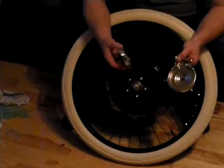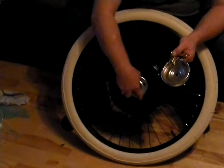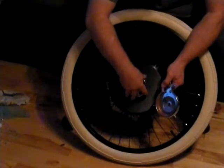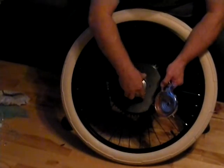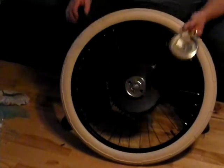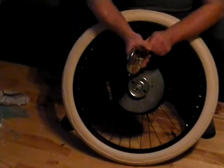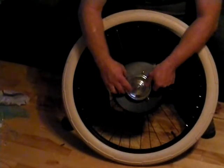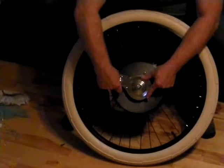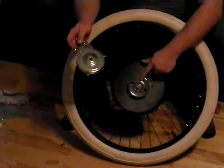The HD Wheel and the HD Axle Kits have brakes. You have to make sure you spin it the right direction. That piece threads on, and then this piece goes on over the top of that. Then this little arm is connected to your brake and activates the brakes — so you actually have a drum brake. That piece threads on and this piece goes over top.